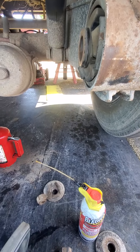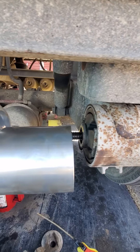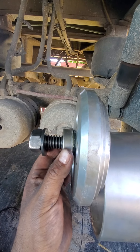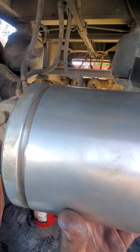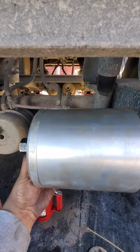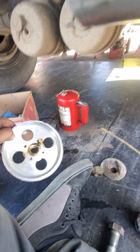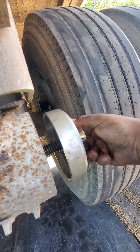I need both hands — I had to put the phone down for a second. So you can get an idea of how it gets set up: you have the pressure bolt here, you have a washer, a bearing washer, then your pressure plate and your compression plate. Make sure the flange is on this side — no flange on this side — so your pressure plate fits there when it's compressed. Now push it all the way in — see how it sits there — then take the other plate and thread it on there.